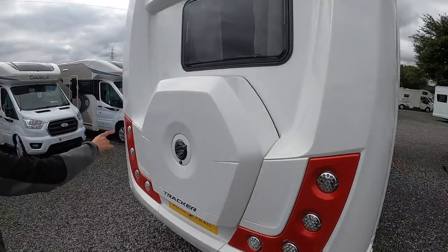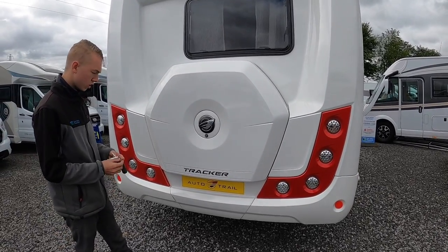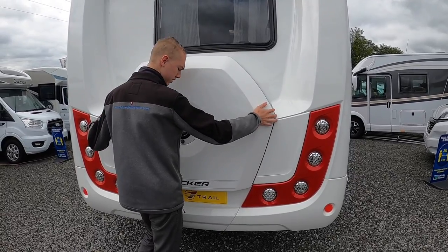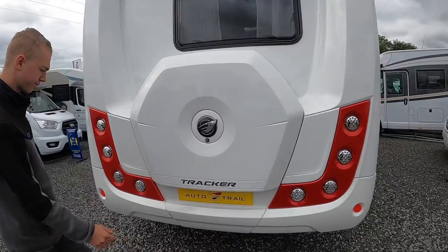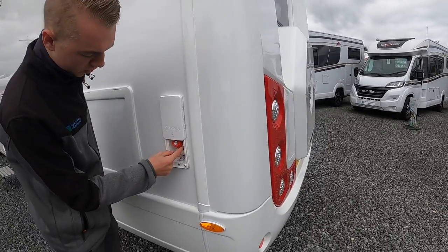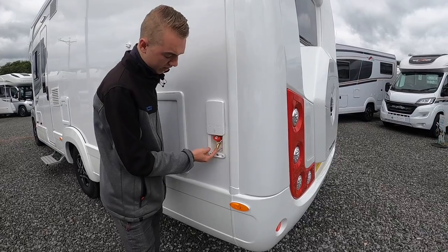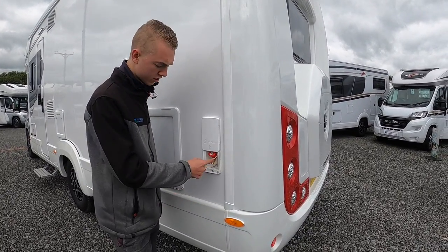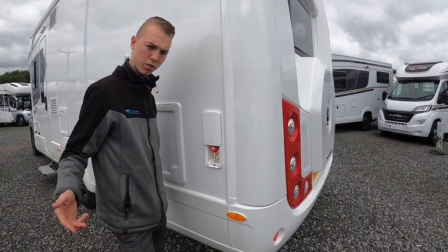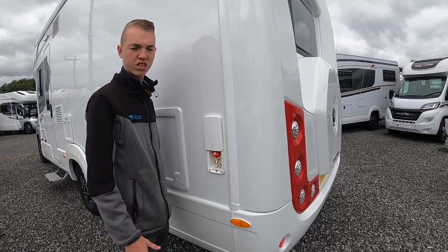Come out the back of the vehicle you've got your high level brake light, built-in reverse camera, and then behind this cover here is where your full size spare wheel lives. You put your key in here, turn this, it will come off — there'll be a big nut which lifts the big fibreglass panel off and then behind that will be your full size spare wheel. You've got your external gas point, and the spigot — you cut that off and connect it in there. You'll need some gas hosing and a jubilee clip to connect the spigot onto the hose, and then connect the other end onto your cadac or gas barbecue with another jubilee clip. You can turn it on and off and this will feed your gas appliance from the main bottle on board, which saves you taking another bottle.